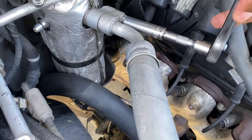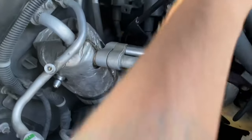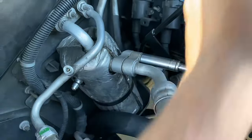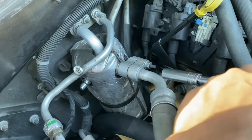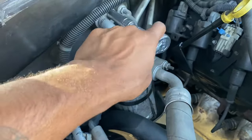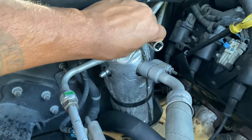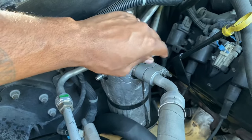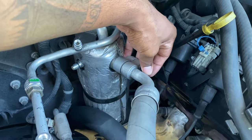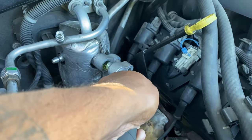With a half-inch socket I loosened up the front bolt leading onto the accumulator. These bolts go onto studs that are screwed into the accumulator — at least this one on the front is. You're going to have to replace that stud or put it onto the new one, so keep that in mind. The other one up top is on a stud that's on a piece inside the car, so you shouldn't have to worry about that one. I got that front line off and put it behind the dipstick to keep it out of the way while pulling out the accumulator.